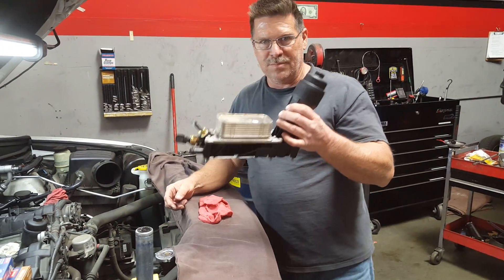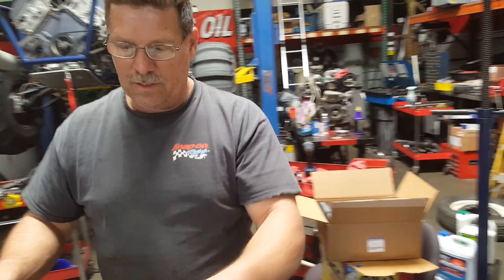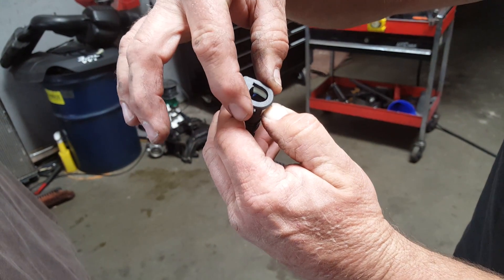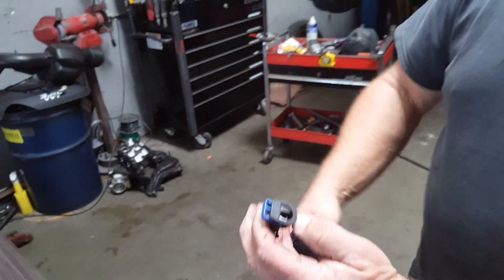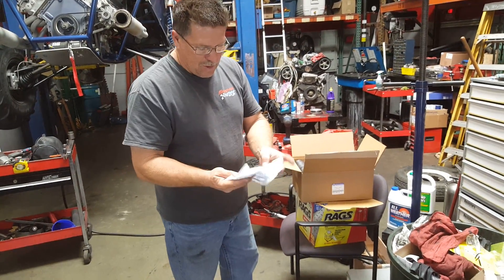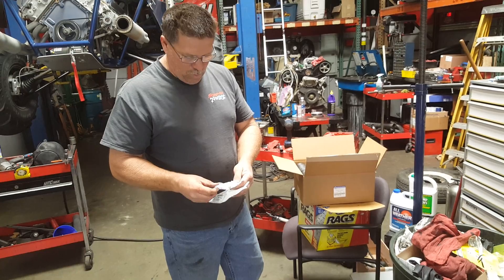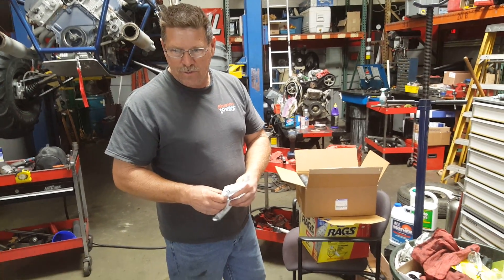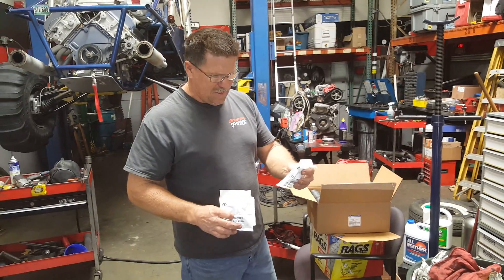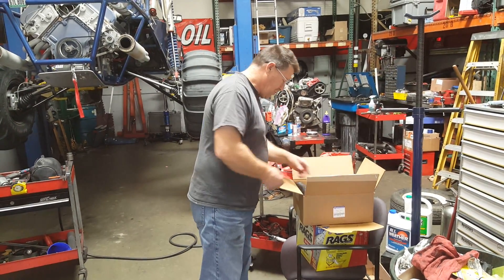The engine oil cooler assembly sits underneath the lower intake plenum. One other issue: the little white quick-clip on the fuel line broke into two pieces when I went to push it, so I had to buy a new fuel line — which was only $14. Also, even though the intake gaskets are technically reusable, this job is being done for a warranty company under an extended warranty program, so I'm replacing them. The gaskets were about 72 cents each, and there are six on the lower and six on the upper — cheap insurance.